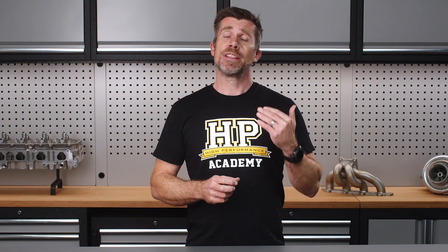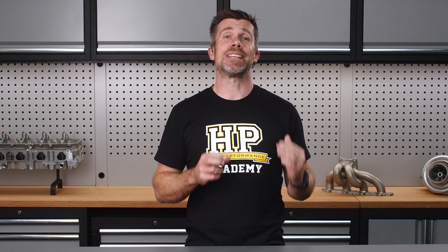The alternator also has a light circuit to indicate when the alternator is charging, and you need to be careful here as some alternators won't begin charging if they don't have this light circuit wired. The older Denso alternators, like the one fitted to our 3UZFE, typically don't require a light circuit, but to be certain, we had the alternator bench tested by our auto electrician before committing to our wiring design. We can use our MoTeC C127 dash and a set of parameters to bring up a warning light if the alternator is in fact not charging once the engine's running.